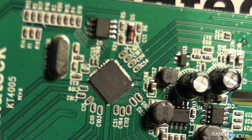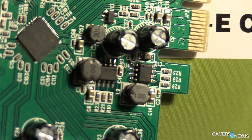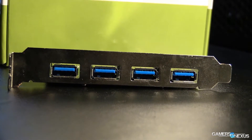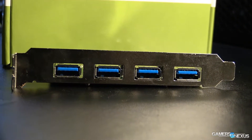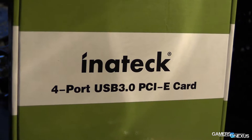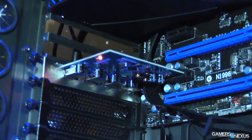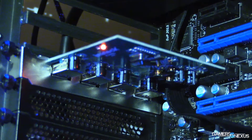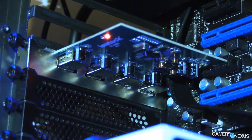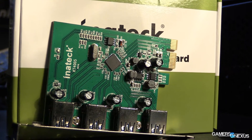So I tested this with three different configurations — technically four, but we're only talking about three here, and two of those are single-stick tests meaning one stick. I used a Corsair Voyager 32GB USB 3.0 stick tested with CrystalDiskMark and HDTune Plus, and then a single stick of Kingston's DataTraveler Ultimate, which is a 32GB very fast USB 3.0 device. Then I did a third test — dual-stick testing, meaning two sticks in the device at the same time, both fully saturated, to test if the controller still performs well under full load from multiple devices doing multiple transfers.